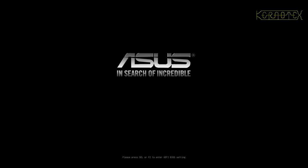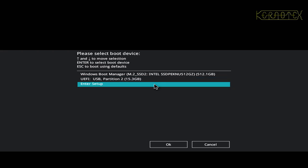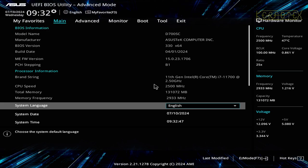I've got to press F8 on this ASUS motherboard to get into the BIOS — or F2 or Delete, depending on what motherboard you've got. The manufacturer might use F12, Delete, F2, F9 — you'd have to find out which button to press when the machine's booting. F8 gives me a boot menu but also the option to enter setup, which is why I tend to use it. This will take me into the BIOS.